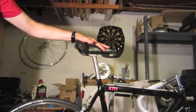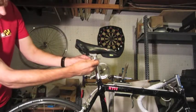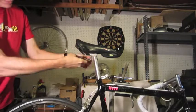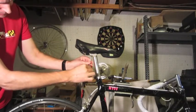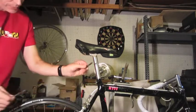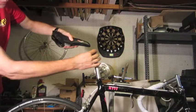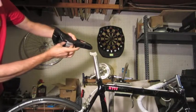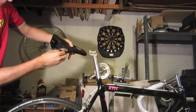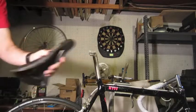We've positioned the bike on the stand and we're going to remove the saddle. You take a 6mm Allen wrench for this one — sometimes they're a different size, 5 or 4; this one's 6. There's a bolt right under there and you just loosen it up. Once you've got it loose, for this style you pretty much just have to take the bolt out. Then you can just lift the saddle right off. There's a part of the seat post that accepts the holder, which fits in to allow adjustment of the fore and aft setting of the saddle.